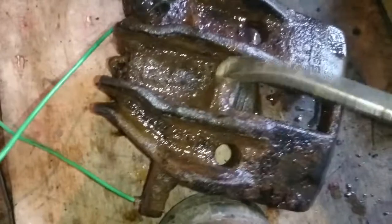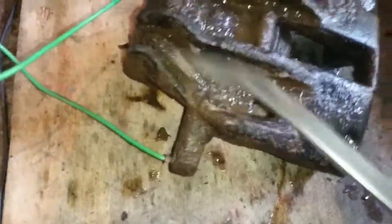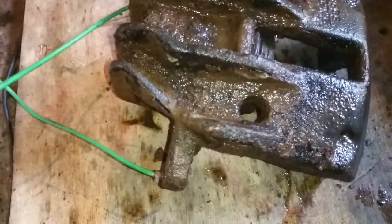That's pretty awesome - it just flakes off like sort of icing. See that thick rusty vessel in there? It's almost like when you soak a pan that's had pasta bake in it - the pasta is rock hard, then you soak it for a while and it just flakes off and rinses off. That's kind of what's happened here with the rust. It soaks it for so long that it just lifts it off the surface. So we'll give it a jet wash - you could do that on a bigger part - or just give it a rub down with a wire brush and see what it looks like.